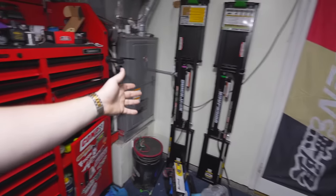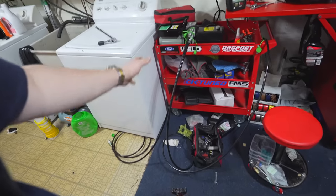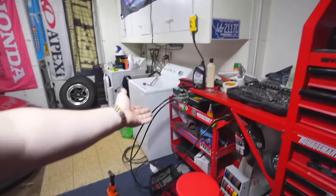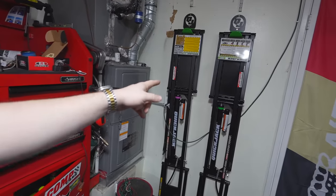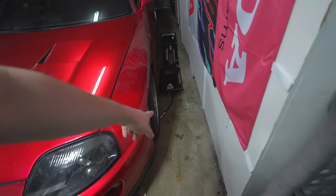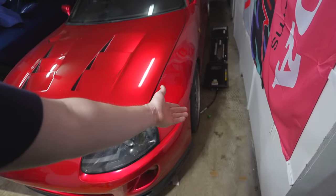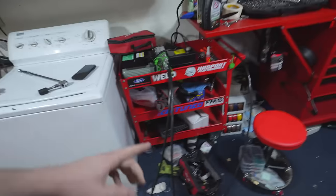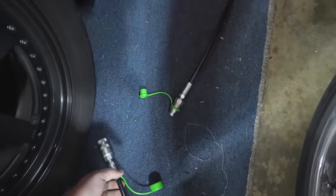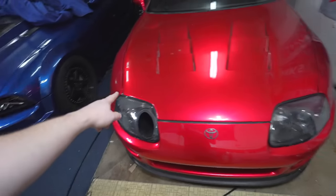In order to do that we've got to get on the QuickJacks. These work hydraulically — it comes with a hydraulic pump right here and has hoses that allow the hydraulics to lift up the vehicle. It's pretty straightforward and really convenient. I've only used them once and I'm already in love. Let me put down the camera and move them into place. I'll show you how they work. I got them right about where I want them. Now we're going to connect the hoses — just make sure the hoses aren't going to go under the vehicle. Then connect with the quick-connect hoses and we're about to save ourselves like 30 minutes. Now I know what you might be thinking: the hoses are going to be in the way when you lift the vehicle. Actually, you get to disconnect them.